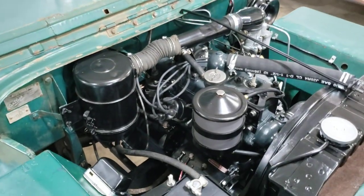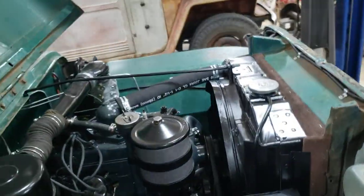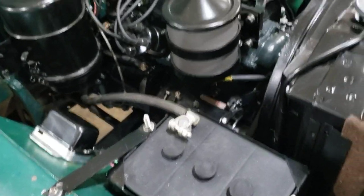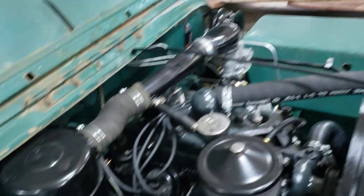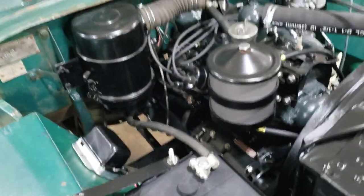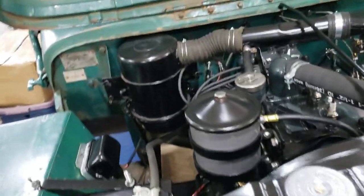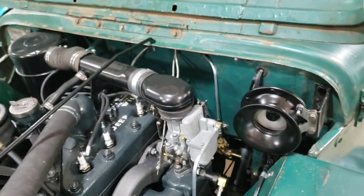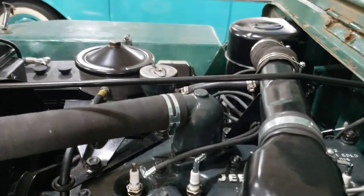We now have everything pretty much squared away as it was born. First thing was a radiator — we had an aftermarket aluminum crappy radiator in place there, which came out. Poor Chuffy had been converted over to 12 volts, so now proudly sporting a 6-volt battery, a rebuilt generator, a rebuilt starter. Completely rewired the vehicle to carry that 6 volts. We do have a keyed coil which will go up under the dash, but just for starting purposes I've got the 6-volt coil on the block. Carburetor was a Solex — that's long gone, of course. Piecing together the parts to put a correct early '46 horn together on here. Lots and lots of holes that had to be filled that shouldn't have been there.